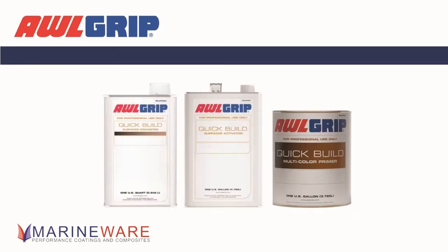We've got a couple of different types of product here. There are two: a surfacer and a sealer. You have a base component and you change the converter or the activator to make it do a different job. The sealer is a one-coat system — a wet-on-wet system, really fast. You can paint it after 15 minutes without sanding. The surfacer has a bit more build to it. You work from a sanded surface such as 180 grit, put three coats on, and the beauty is you can sand it after an hour. They both have a different function, but it's all about speed.